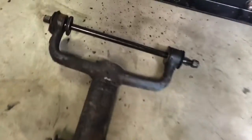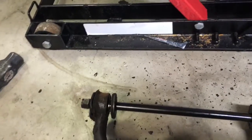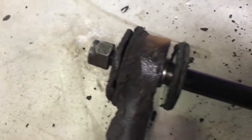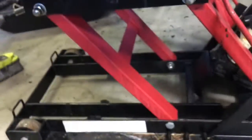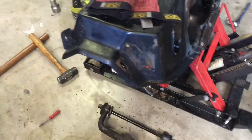All right, this is the driver's side half shaft. Here I'm documenting what was on the car, not what is right. I'll need to look in the manuals or the SNG Barratt catalog, which has good exploded diagrams. So on the driver's side, the front, there was one big washer on the outside, and two big washers on the inside. On the back, there's one big washer on the outside and one big washer on the inside. Now, interestingly enough, this is also the side with the tear in the frame. So I don't know if those are related or not. But we have the documentation now, so I'm going to go ahead and pop that other side out.